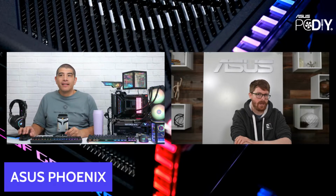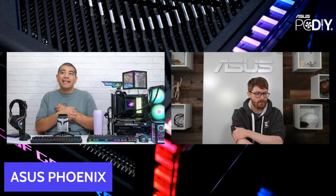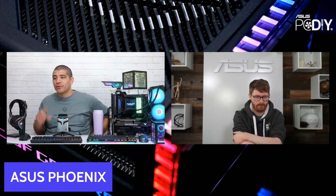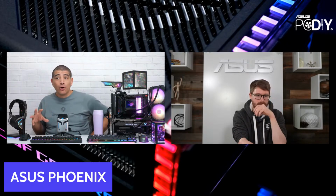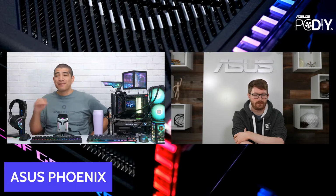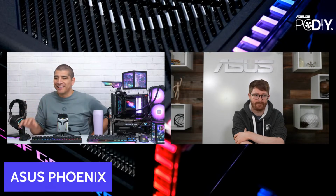So something like that. And the other thing that I like too, depending on the model you're looking at, is that I love cards that don't even have any PCI Express power connectors, right? Of course, you have to get to cards that have a pretty low power target in terms of their power consumption, so generally you have to be under 75 watts. But for the cards that do have that, that's really cool, because literally it's just plug it in and there are no cables. It's literally just plug it straight into the graphics card slot.